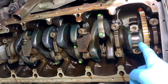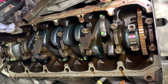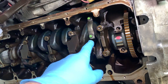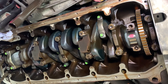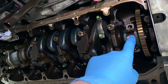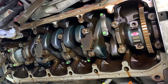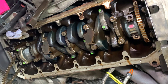It's not just this one we've measured — we've measured every single one, all six of yours, and we do that on every single engine we've ever done conrod bearings on, full stop. We just don't video every one because otherwise it would be very repetitive and well over an hour long. All the data gathered — torque values for the bolts and clearance values for the bearings — we record on a sheet as we go along and we'll give you a copy of that at the end, which we call a conrod bearing data sheet.